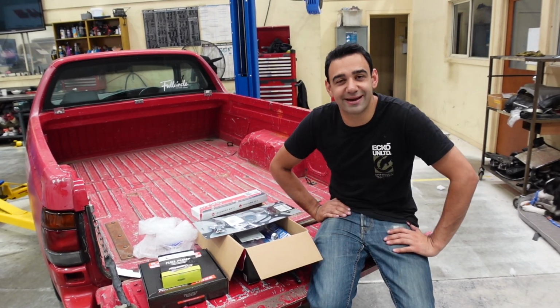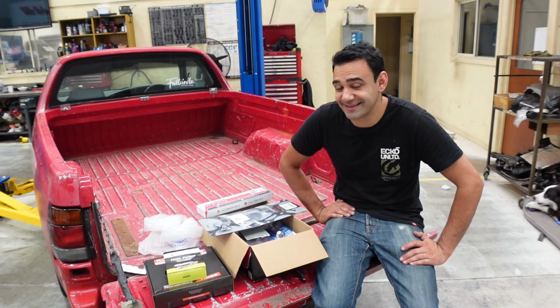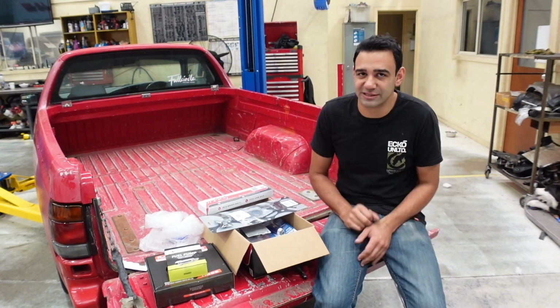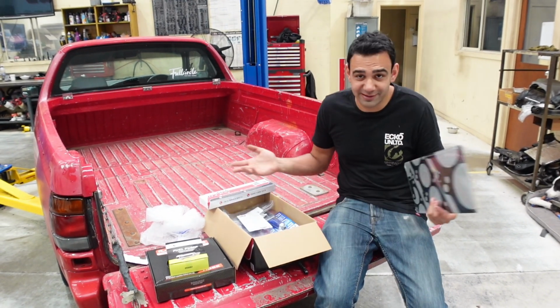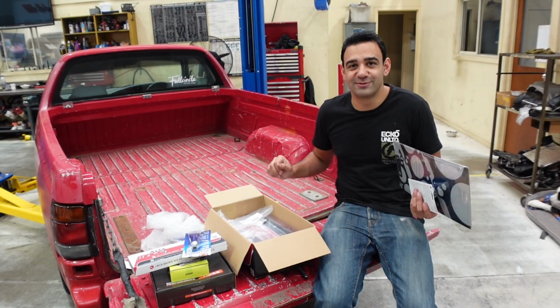But as soon as we started it up, it still leaked oil, and that is because it's actually got an intake manifold gasket leak as well. And it's got a little miss because of that. So, if we're going to do intake manifold gaskets, why not put a little extra effort in? We'll do some basic performance goodies.